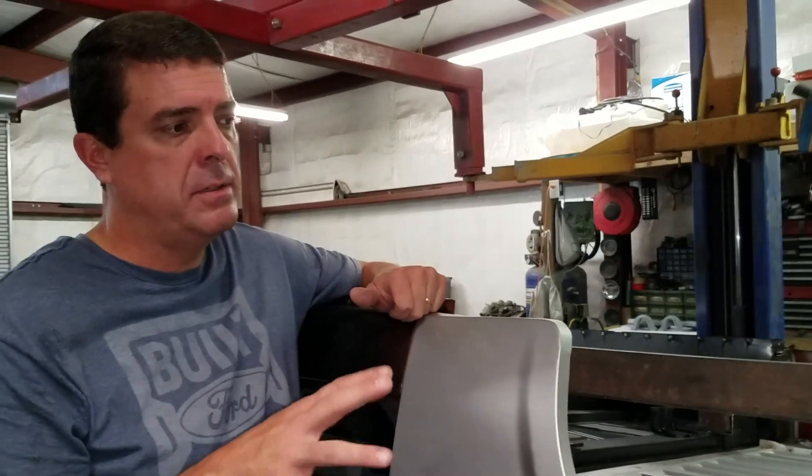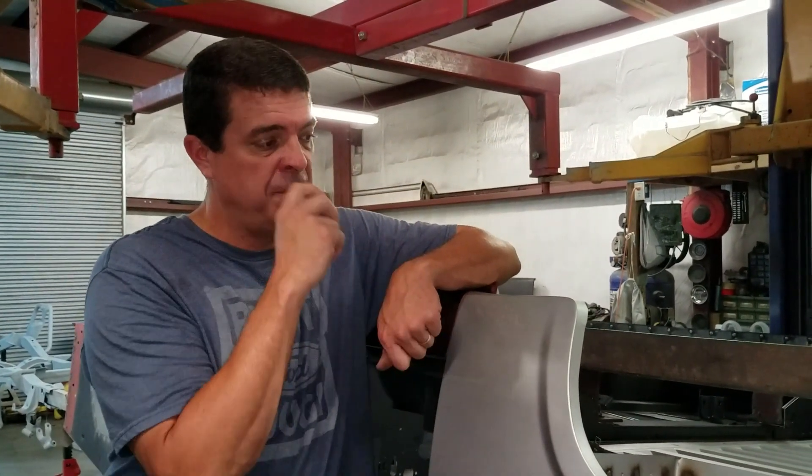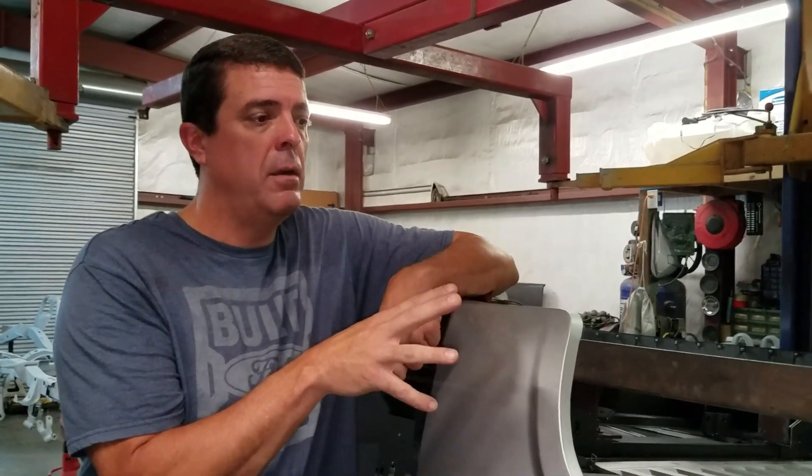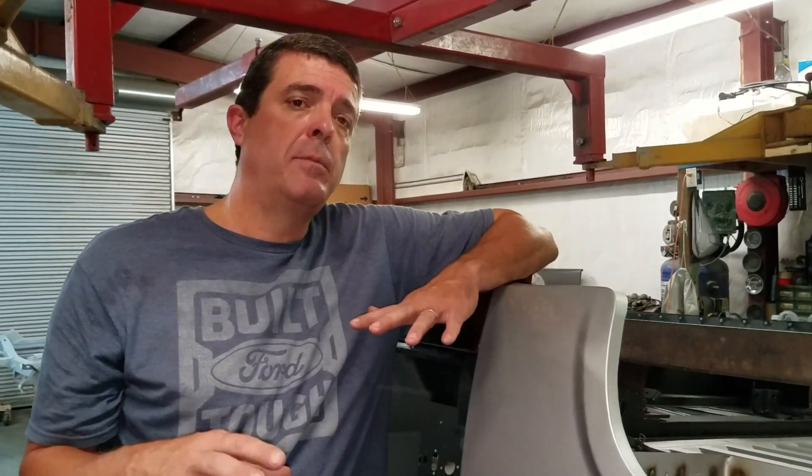I've got a pretty good punch list but I can knock it out in a few hours. We're going to fix any grinding, add spot welds to the tubs, and make sure the floor is plenty sturdy for the roll bar. I'm also going to try to tie the roll bar to the frame — once we get it set in and the frame is back under it, I can start planning a frame tie so the bottom of the roll cage is connected to the frame. That way it doesn't try to punch through the steel if we were to roll it, just for a little added safety. We'll talk more about that in one of the next videos.